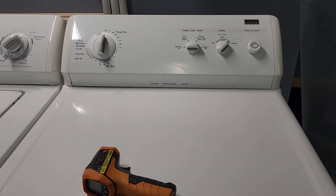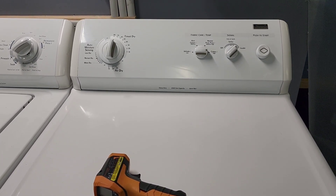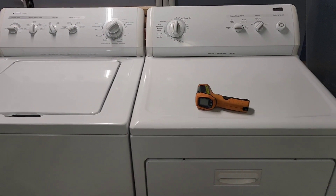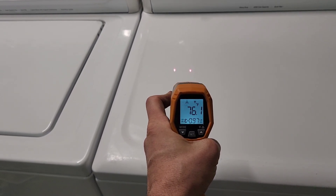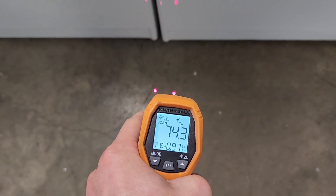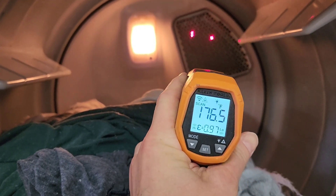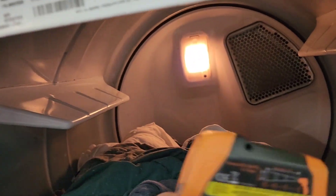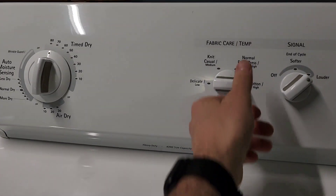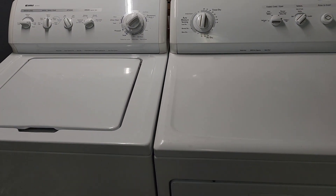You can see inside — sounds great with nice smooth operation. It'll actually be a little quieter once you have the vent hose on the back in your laundry room, which muffles most of the sound. I've given it a couple more minutes to warm up and I'm using my heat temperature gun between the two red dots for a surface reading. I'll shine it right inside the heating element tube — there's plenty of heat coming out. That will heat the inside of the dryer anywhere from about 95 up to 195 degrees depending on your heat setting, which we have on high.